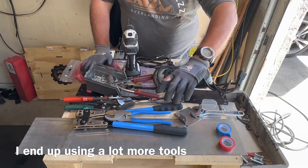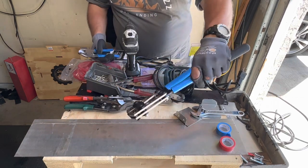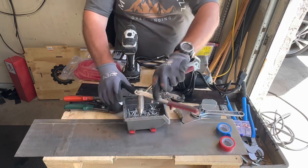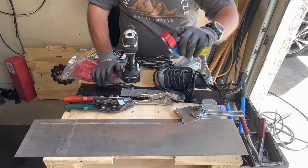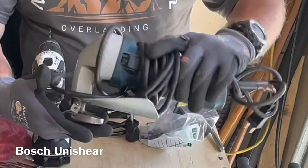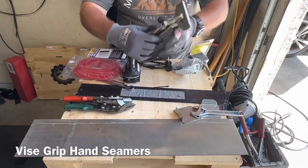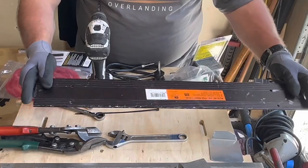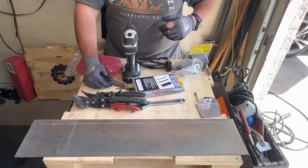Let me show you some of the tools and parts I put together to get this job done. If I need to shorten my winch positive electrical lead, I've got my cutters. I've got my clamps and crimpers for crimping a new end on that electrical lead. I'm going to use a pop rivet gun and a couple of pop rivets to pop rivet my electrical disconnect onto the bracket I'm going to make. I'll need a little electrical tape. This tool here is called a Unishear — it's an electrically powered shear for cutting sheet metal. The stainless steel is real tough so it's real nice to have a powered shear. These are hand seamers used for bending sheet metal, and a bar folder for folding an end on sheet metal — I'll be able to fold a 3/8 or a half inch up on my bracket. I've also got hand shears for cutting and notching the sheet metal.